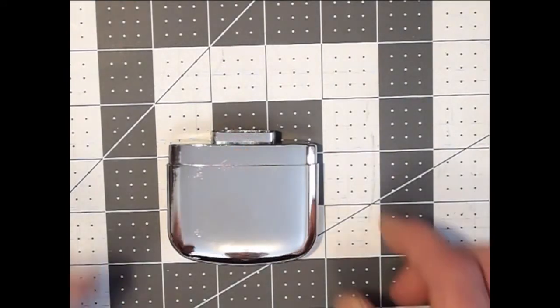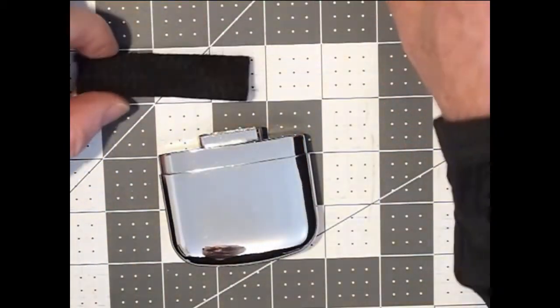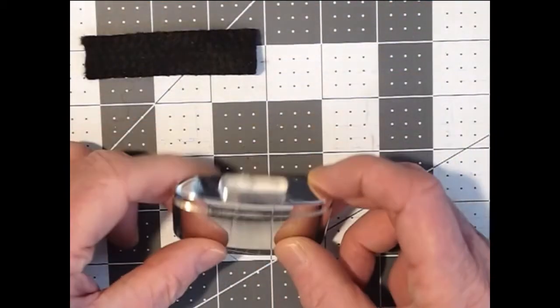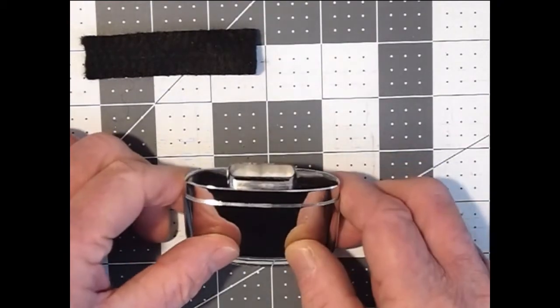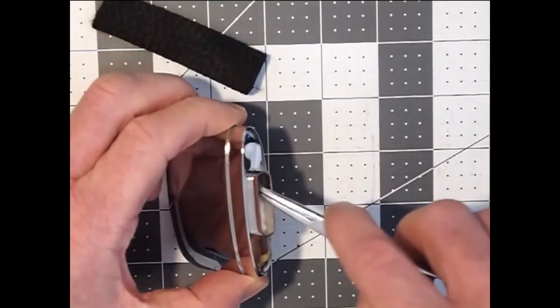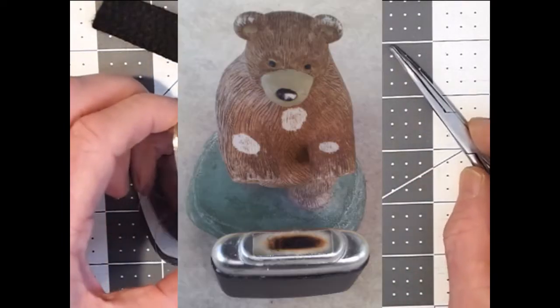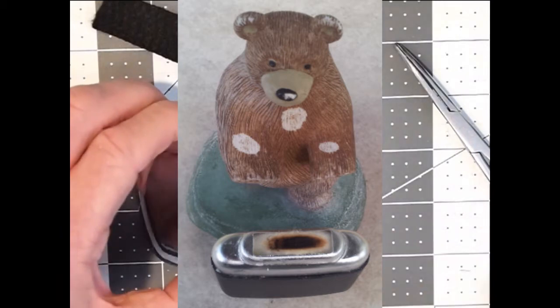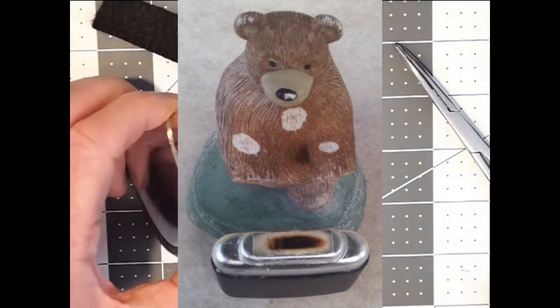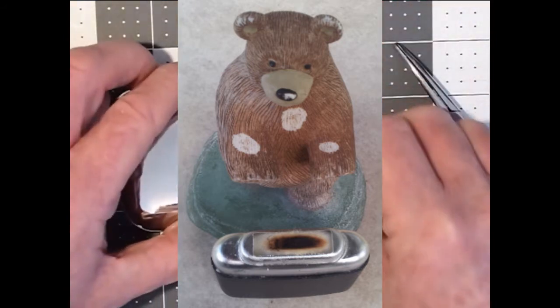Now we have your carbon felt strips. You get two of them in a kit, which can do two hand warmers. How to use those? Their intention is to protect the top of the cotton, or the top of your reservoir, from getting charred, because when it gets charred, that forms a barrier to the evaporation of fumes and eventually blocks them and disables the hand warmer.